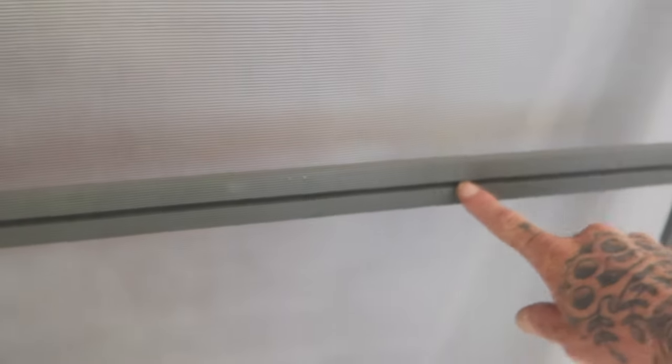And what I always like to do as well is how I've done all these ones, exactly the same. This one's the window. I haven't taped up these yet, but these are obviously the screens. So what I'll do is unscrew these, and then I'll tape up the fly screen. But in saying that, I really need to take out the fly screen on this one, because you have this edge that's through here. If I just taped it completely up and painted your perimeter, you're going to see that edge from the inside, which you don't want.